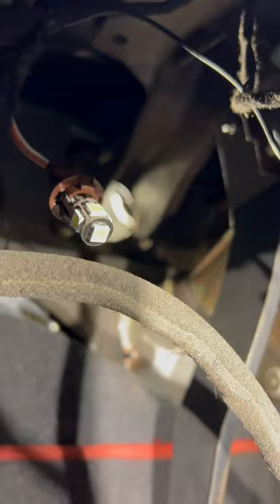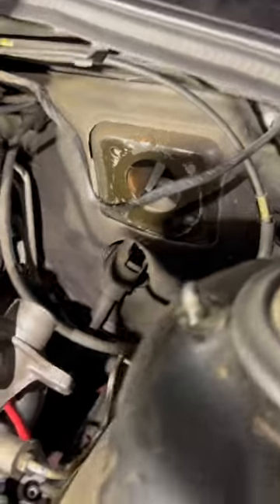It's still a pain to get the hump of the brake pedal up into there — even if you took the brake pedal off it wouldn't be any easier. That's on the inside of the car, but on the outside you have to take the power booster all the way off.